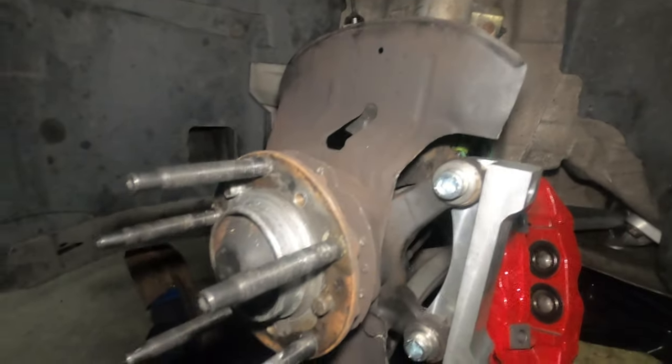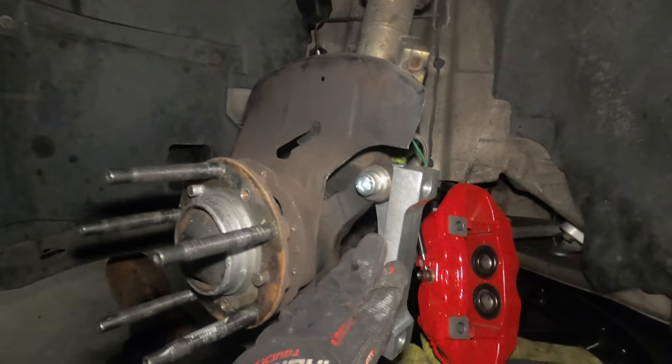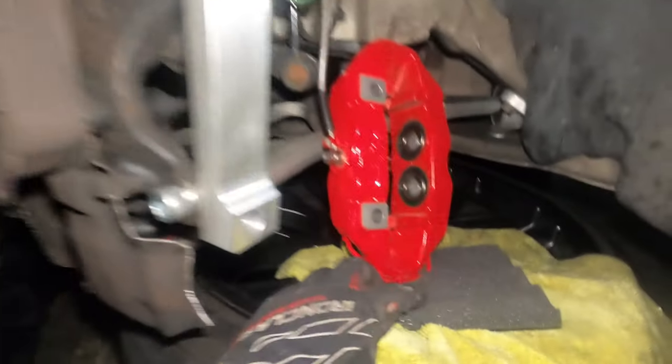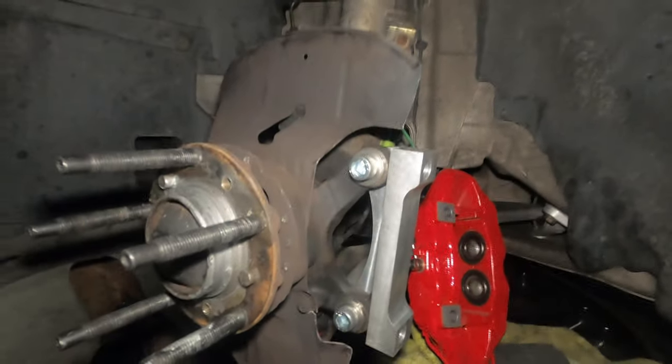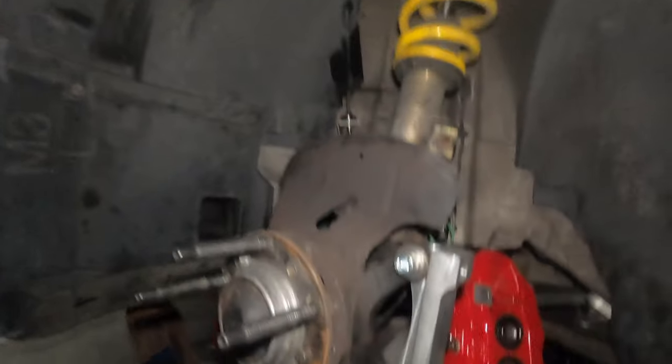Now I'm going to go ahead and mount everything. I already installed the brake lines but haven't bled them yet. After I install everything and put the pads, then I'll bleed the system. I did a test fitment with the car on the ground and it is perfect — not rubbing. I don't know which offset I have on my wheels but I'll put the specs in the description. It's fitting perfectly front and rear, so let me finish the installation of the calipers, pads, and then show you how this looks with the car down.